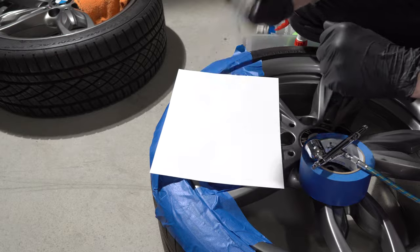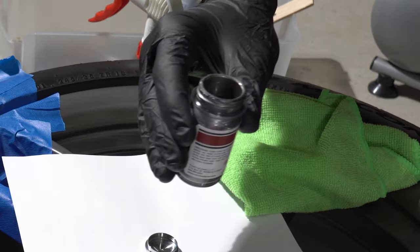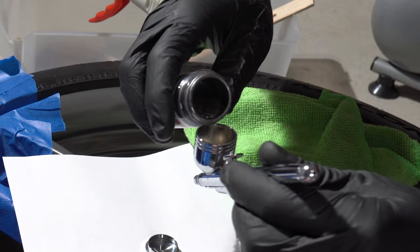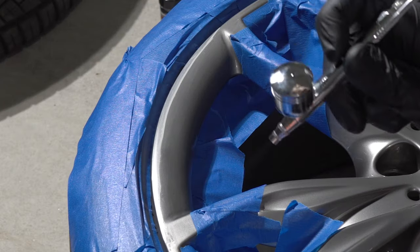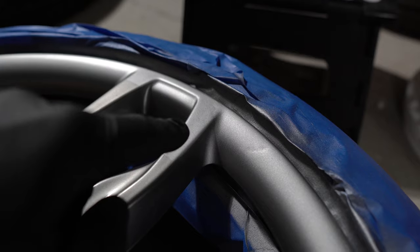The second thing: I didn't mix the paint good enough or shake it. Since it's metallic and has some particles in it, they need to be mixed very well. On the other hand, it's really thick paint, which makes it great for testing the airbrush. We can also use a paint reducer, but more or less this was just a test run, so I guess it's okay.